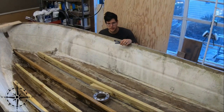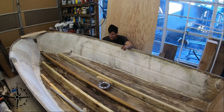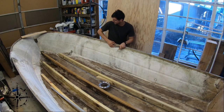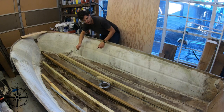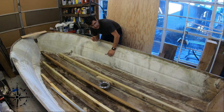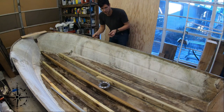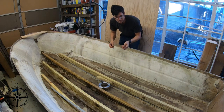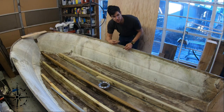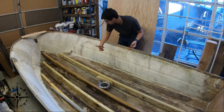This is pretty cool the way it works. The only two tools you really need to get these measurements are a small stiff measuring tool and a pencil, pen, marker, crayon — anything that can write. You'll notice this piece of wood sitting here has its nose up as far as it's going to be, and then it kind of gradually comes back down. I already know my transom is just a gap of six millimeters at the top as opposed to the bottom touching. So all you do is take your piece of wood, measure in six millimeters at the top or bottom, make a mark, and then cut an angle from that point to the tip of the wood. That gets you your reverse angle to the transom — that's the first cut we're going to do.